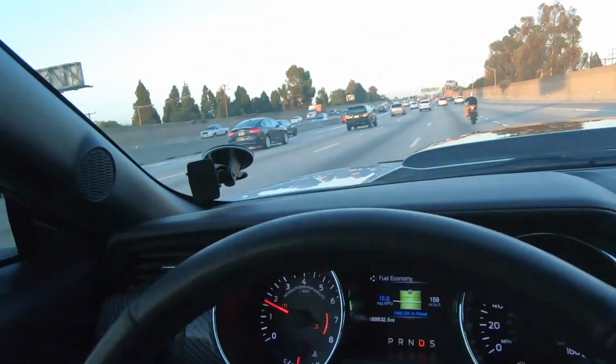So continuing on how I feel about the car when my throttle tube is actually connected. The throttle response is about the same as it was when I was NA. And I just think because of how my bypass valve is adjusted, I am not in boost right now until I hit about 3 grand. And that's a cool thing.